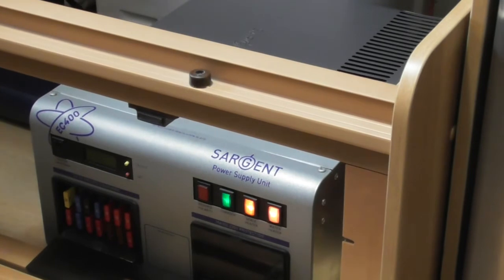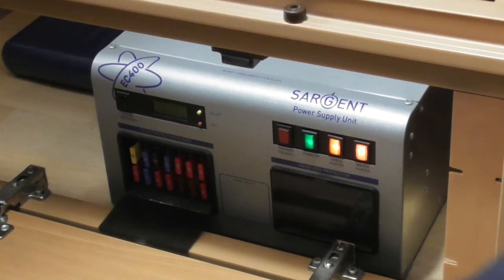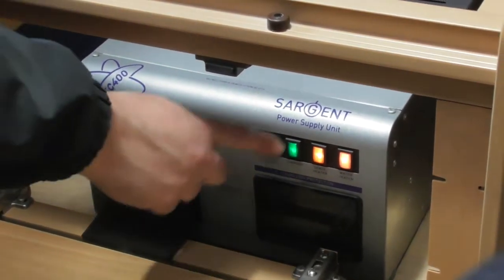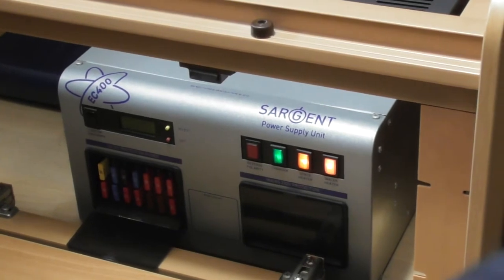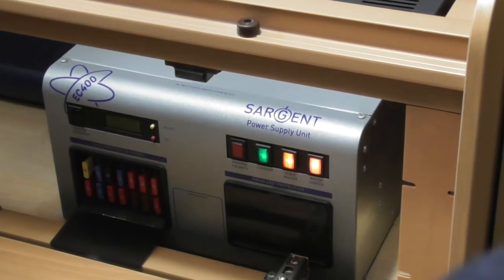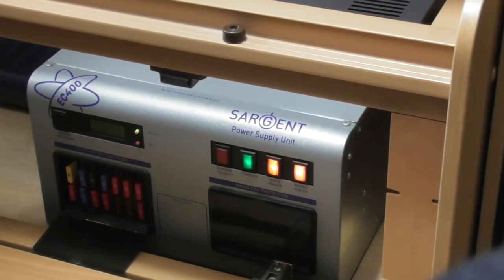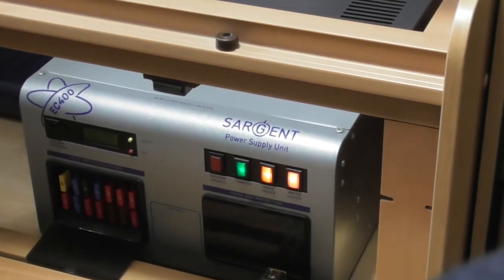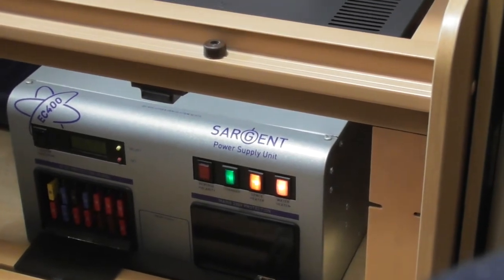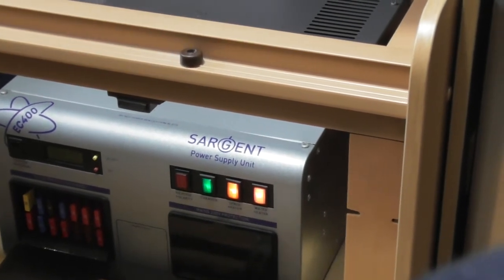Now, you're planning on going abroad with your van? Possibly. Main thing is the French and Germans are slightly backwards to us. All it is, their power's reversed. So their negatives are positive as such. If you ever do go abroad and plug in, if you see that red light lit up there, it's letting you know there's a problem with the power externally. It won't power the van up because it shuts the power off inside that unit so it doesn't frazzle your electrics inside. So what do you have to do? Then it's either a rewire of your leads or an adapter externally. But most of the time the foreign campsites will, if you can speak the language, help you out to get the power on. Cool. So there's an adapter that you fit on? Yeah, there's an adapter you can fit externally, which just sort of crosses it back over.